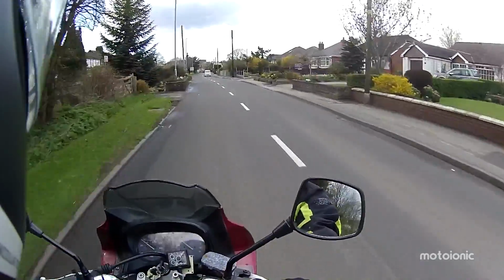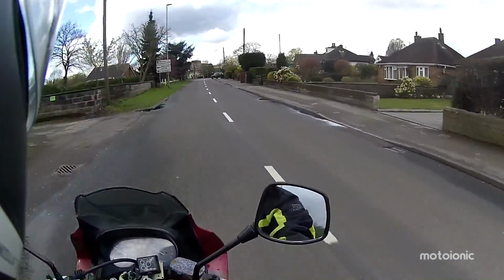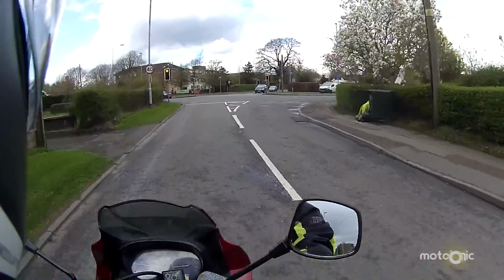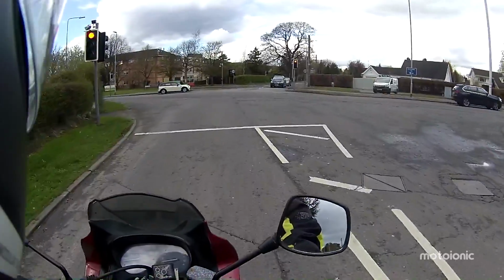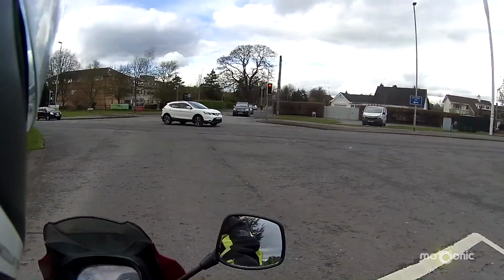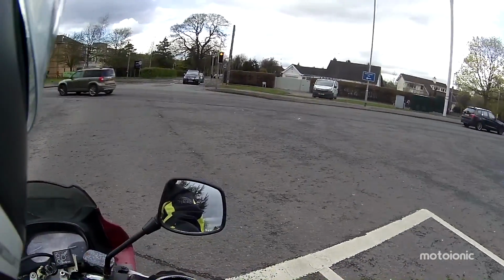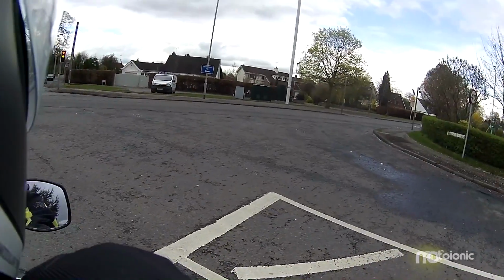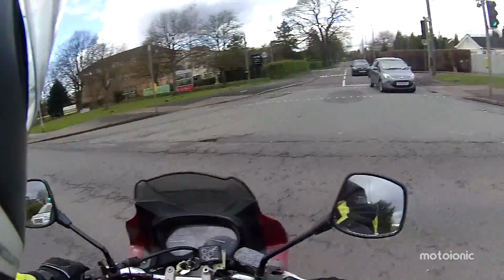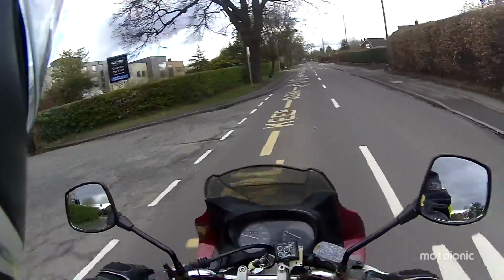Anyway, today's video is going to talk about a little issue I had on the bike. I went to work on it last Saturday and got to work fine, and just turning onto the estate where work is, I noticed that the indicators were flashing dim, and then when I put it into neutral it was very dim, the old neutral light there. So I switched it off, switched it back on again and tried to start it, and sure enough, the battery's flat.